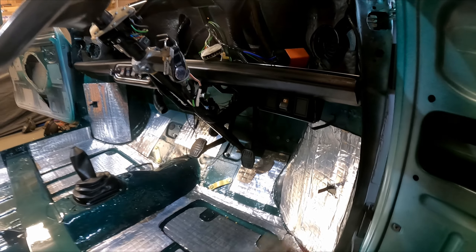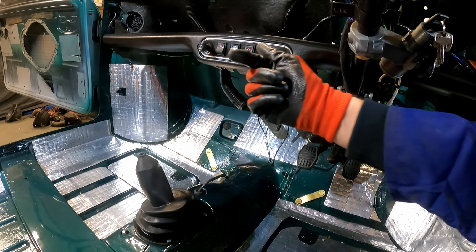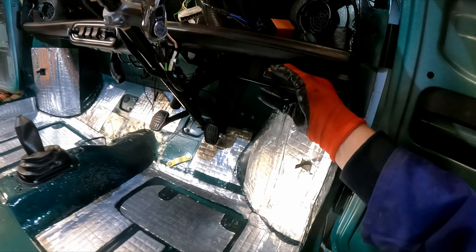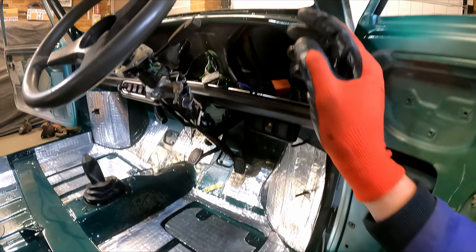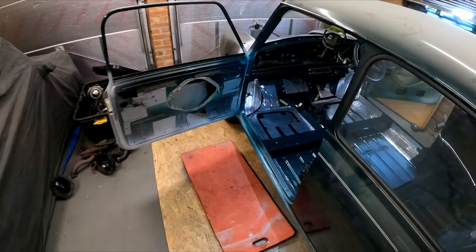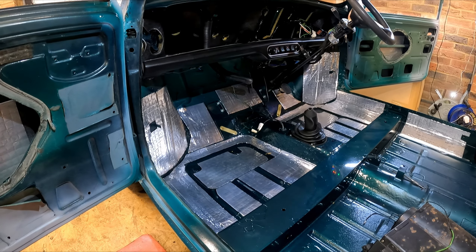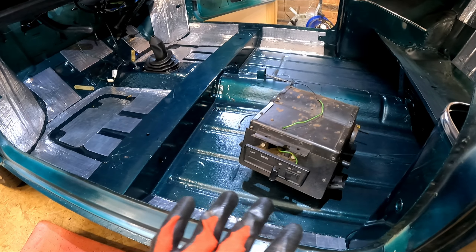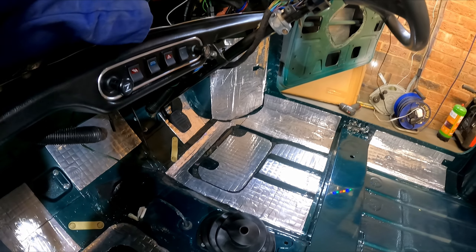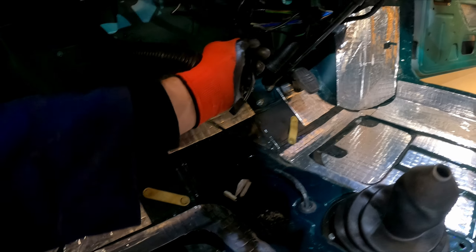All the wiring's in now. My only little complaint about that loom is the little wires which go on the back of the switches for the illumination of the lights - the insulation on them is too fat, really really difficult to get them back through the holes. I need to get the speedo back in, I'll be back on that in a moment. I had a subscriber request from Kieran asking which wires go to the heater - I said I'd let him know when I got this far. I'm not going to put that heater in yet because it needs to be fully overhauled, but all the wires have homes now.